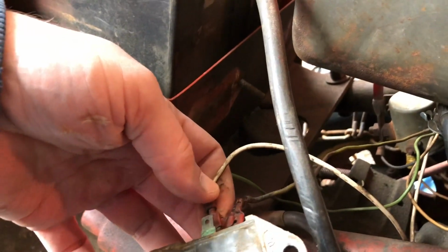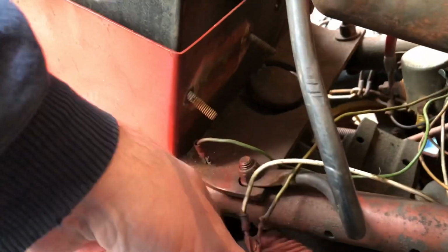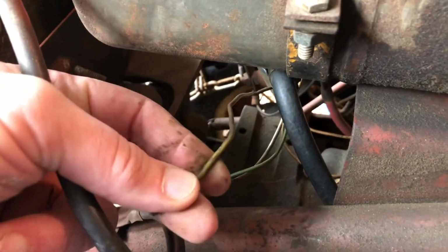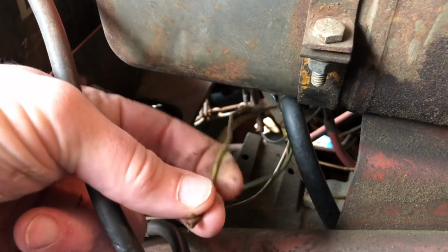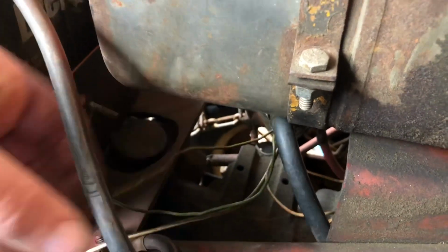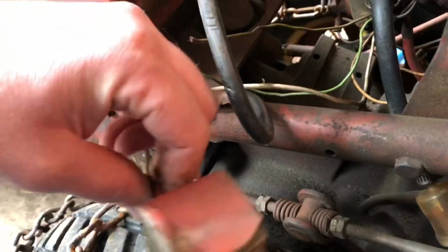It's actually a Kohler part. I see the 41-30306 on there. And yeah, look, this thing already busted off. Someone had built these wires at some point. They're way too small. They should be bigger diameter wire than this. This looks like it's 18 gauge or something, which is way too light. So let's just take all this junk out and start from scratch here.